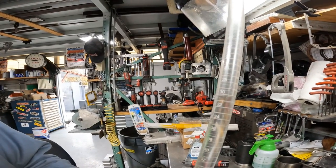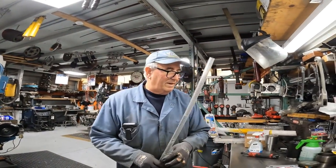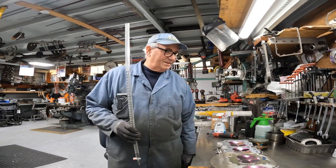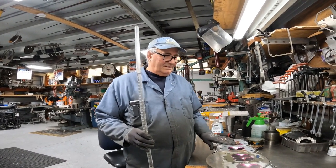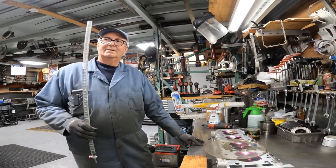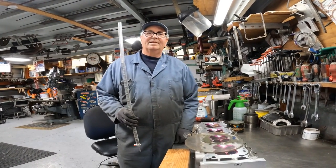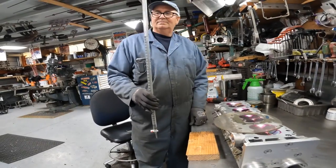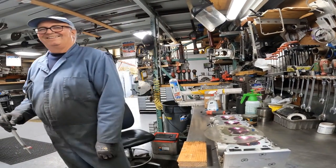We got... right at 30. So that's 30 cc's? 30 cc chamber. We have to use that to calculate out the compression ratio and everything — that's how we measure it. I'll usually do a couple, just to make sure that they're consistent, make sure I didn't have one that's way different. When we're doing the compression ratio, we figure that out and see what size pistons we need to put in it. It's really not too scientific — you're just using a Lexan plate with a hole drilled in it, using grease to seal the chamber. That's as scientific as it gets — good old-fashioned stuff works.